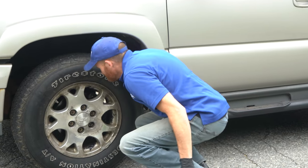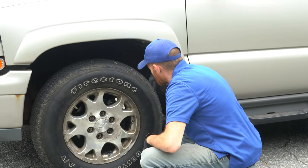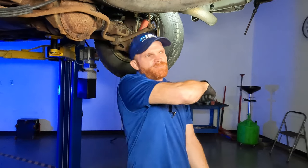If you're driving down the road, you might not even notice it right away, but you might have a weird smell coming from one of the brakes. If you raise your vehicle up and try to spin that wheel, it might feel like it's binding up a little bit, because those shoes have expanded and are now holding onto the brake drum material.